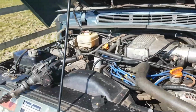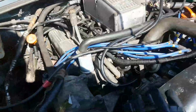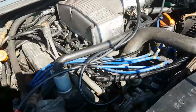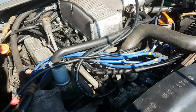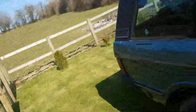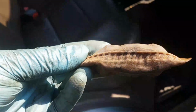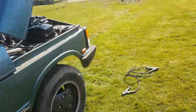And this is kind of where I got to the point of pulling the fuel tank off. This is where my 99% of ignition related problems are fuel related, and vice versa. Pulled the fuel tank off and found an obvious fault: a bunged up filter, you've seen it. The thing was rock solid. In fact, I might even enclose it in resin as a small gift. Look at that little paperweight. Let's drop that down there. So yes, there was a problem with that.